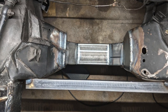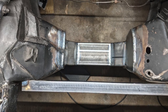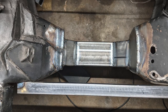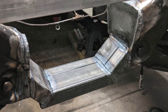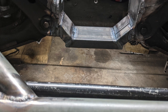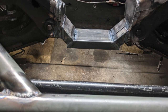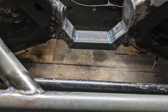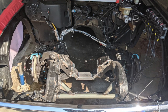What I ended up doing here is bracing with square tubing across the front of the subframe. Once I knew the frame wasn't going to move — because I had the K-member welded in as well as that brace — I was able to cut the two sides out with a Sawzall, plate it, and then use rectangular tubing cut at the right angles and weld it into the frame. With the subframe welded in between the two points in the chassis, the oil pan can now clear, and then it's time to figure out how to mount the rack and pinion.